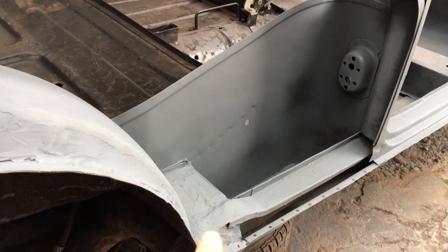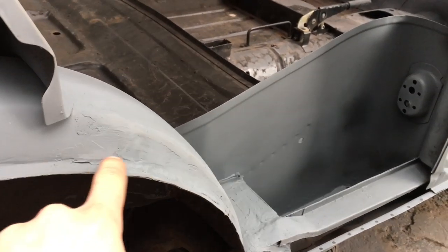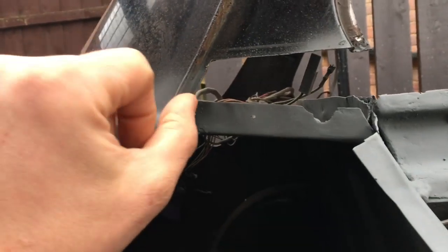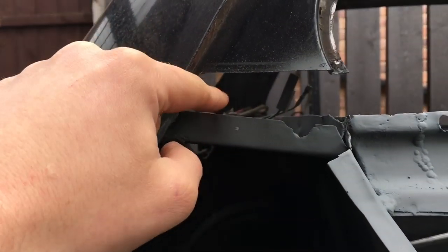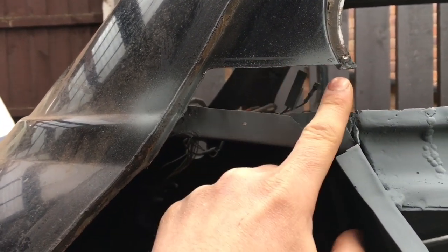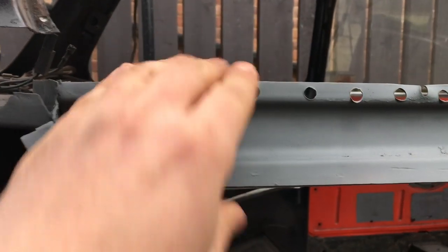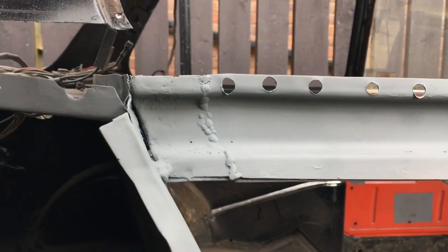All this is ready to go - this is all seam sealer, that's all in primer. The repair here has been seam sealed, all in primer, all nice and solid. It does need cleaning back but we'll sort that out. Back here I've still got to trim back what's left of the quarter. Unfortunately the quarter doesn't come up quite high enough in this area, so what I'm going to have to do is fit the quarter, weld it to this section, and just make a little piece to go in there. We got the outer skin piece with this panel so I should have the profile to make that little piece.